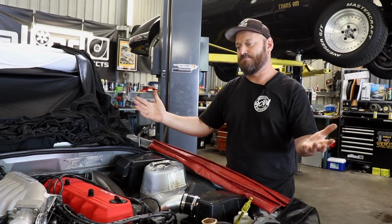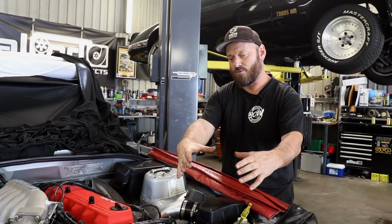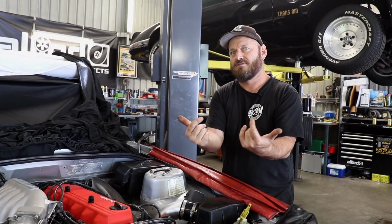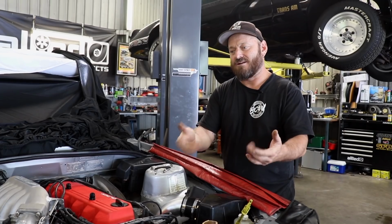Engine starts heating up, it's not over. It should stabilise and just sit there idling, hot water in your funnel bucket or whatever, spitting out air bubbles. The air bubbles are what you've got to get out, because there shouldn't be any air in the cooling system, because air does not cool engines down. So keep going until that happens.